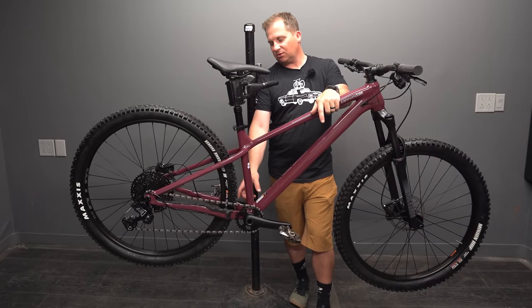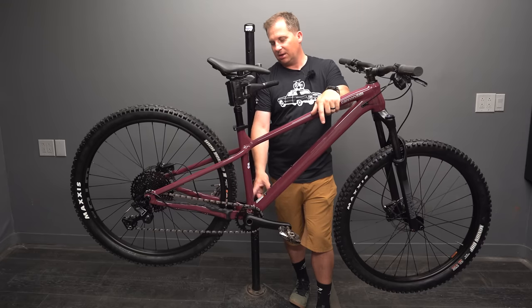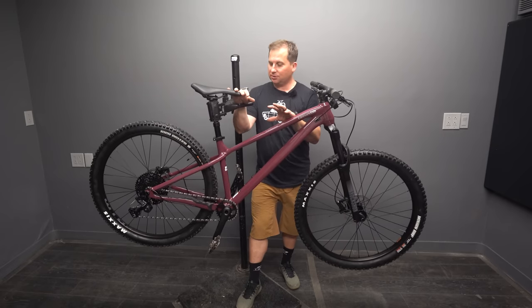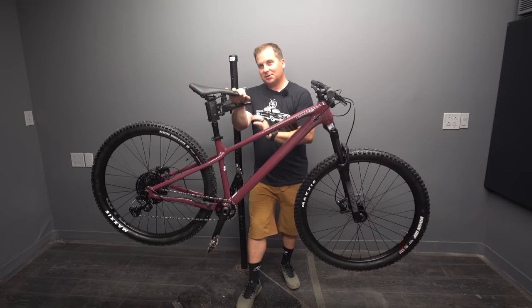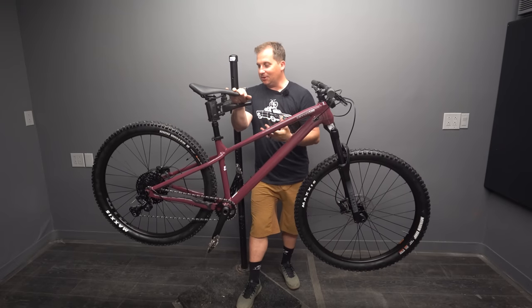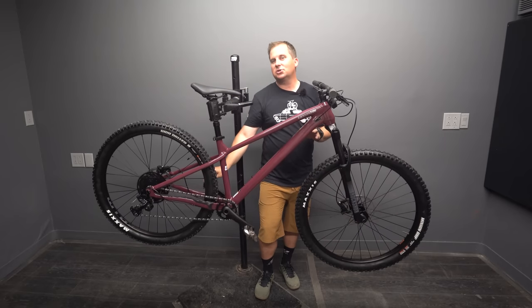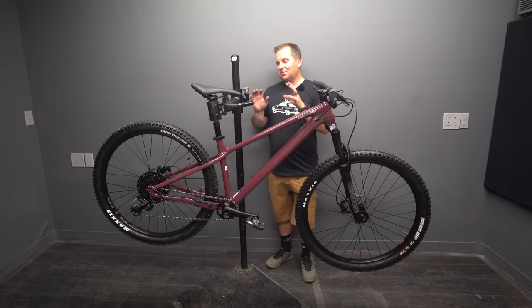Why are we still using those rubber plugs? They're such more elegant solutions. We've also got a SRAM UDH, the Universal Derailleur Hanger, on there. Hardtails have kind of been the last bikes to get those, and it's exciting to see them coming to hardtails.